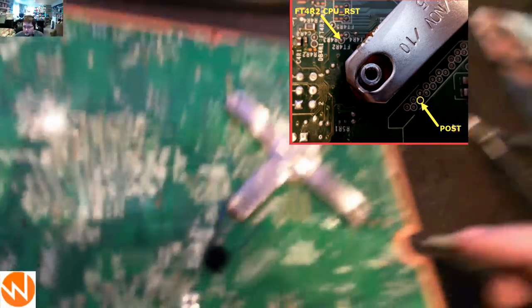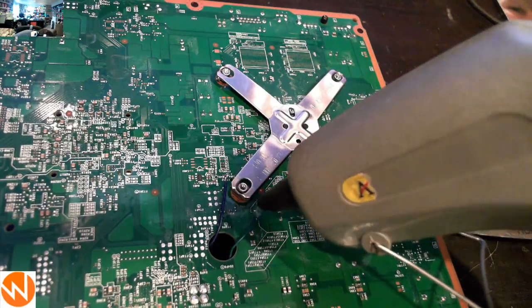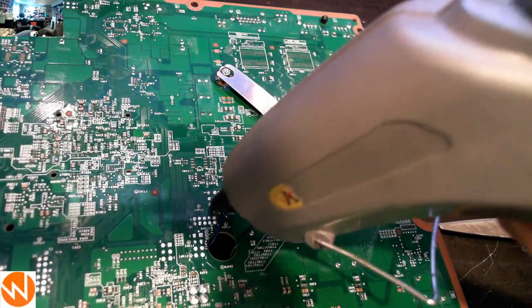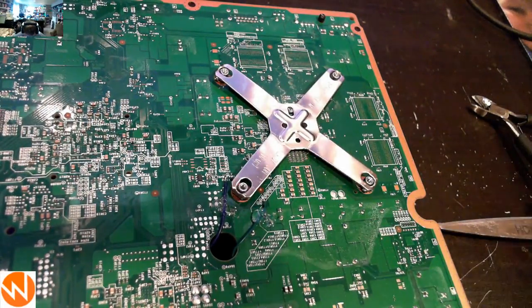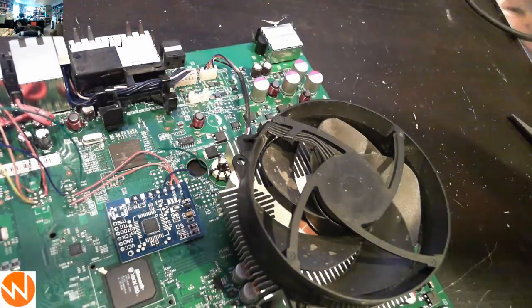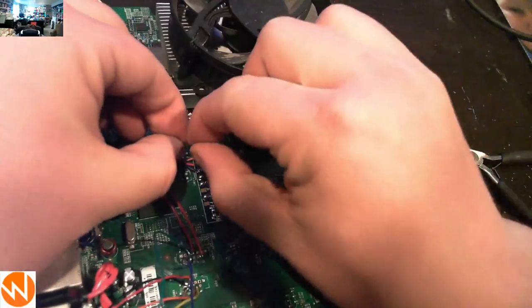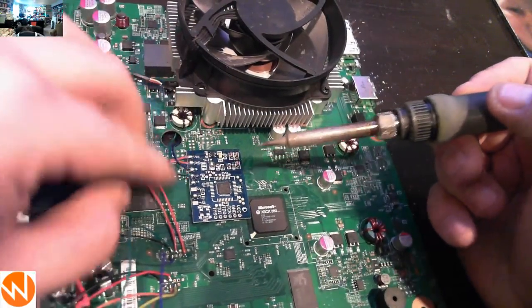Now with both wires installed on the underside, the POST wire on pad B isn't connected to anything yet. Apply a little hot glue back away from the solder points but onto the wires — this provides strain relief so that if the wires get accidentally tugged, you're pulling against hot glue rather than ripping the pads off the motherboard. Trim the POST wire and solder it to pad B. Feel free to rotate the motherboard to get the best angle while working — there's no need to be rigid about positioning.